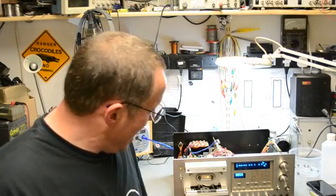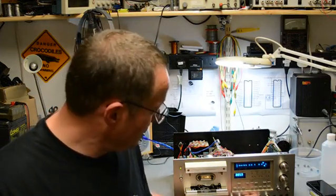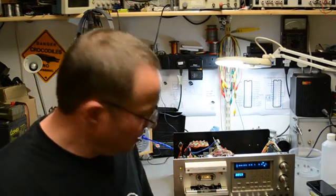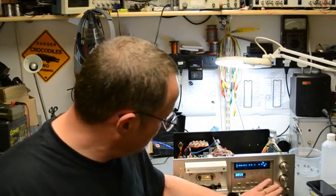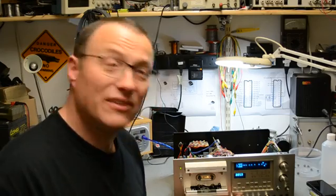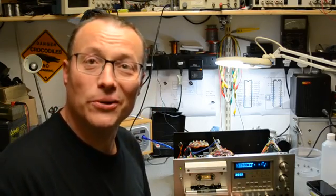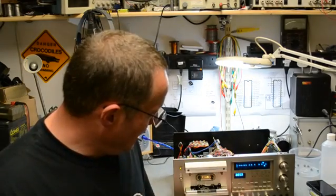But there we go — a marvellous machine. It's got a calibration system for bias level and EQ which is really quite good. It's a three-head machine, which means you can listen to your recording as you're making it, and this is used during the calibration signal — it puts some tones out. You can't even hear the top one, or I can't anyway. My hearing was once wonderful enough but not probably anymore. They allow you to set the bias level and EQ.